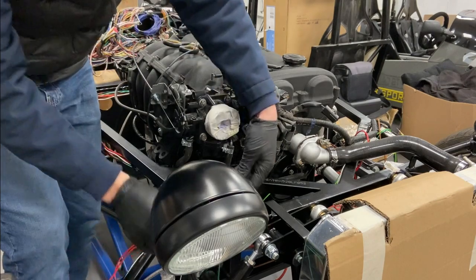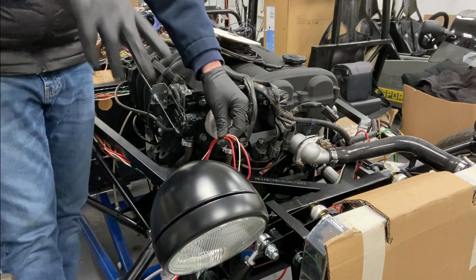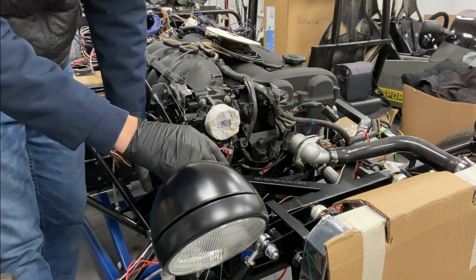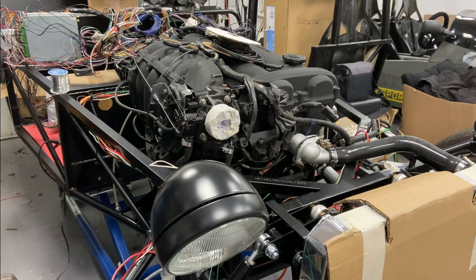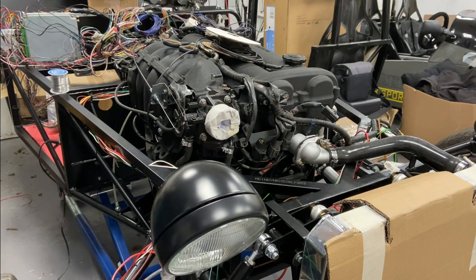This is about the right length — I need to cut that about there, and that's going to form the basis of the plug for the right-hand headlight. That's a six-way plug. I'm going to put the pinouts in the right place — in the right order. I need to go find out exactly what they are, but I'm going to be running a side light, an earth, side light and earth, and then three for the headlights. Easy peasy.